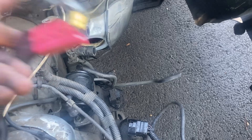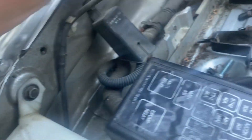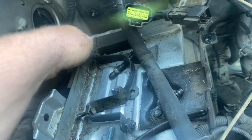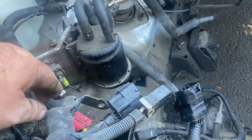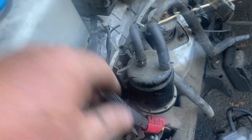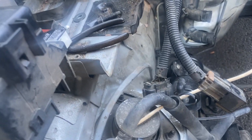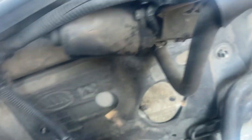We are damn near loose. There's another spot over here where it's connected and it goes into this cavity — I think that's where we cut it. I cut a wire — there was an extra wire from the positive side of the battery cable down to this breaker and it goes from there back under the car somewhere. It possibly goes to the fuel pump — I'll run that down later. I also cut the cable to the wiper harness and pulled the relay off.